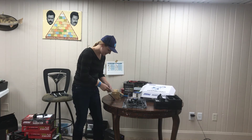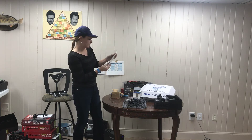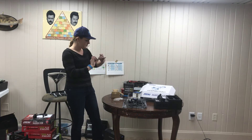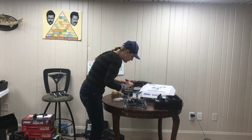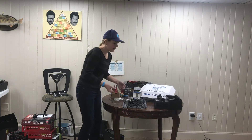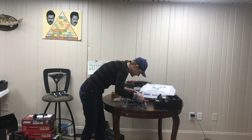So this is the memory. Like I said, I'm not entirely sure about it — it's very close to the model numbers that show up in the specification, but it's a little bit different. The model number is AX4U2666W4G16-DRG, which didn't show up on the list. But we're going to give it a try. For the memory, you're going to check the motherboard specifications to figure out which DIMM slot to use. For MSI, I think it's always DIMM A — I checked it ahead of time.